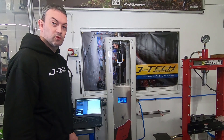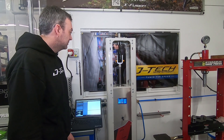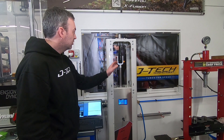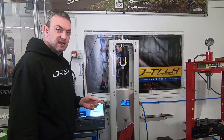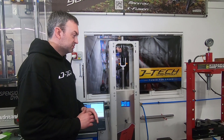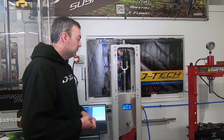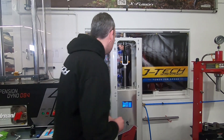In this test we're going to test two different shocks but three different springs. We've got a RockShox Super Deluxe Air with a Debonair air can first, then we're going to put a Meg Neg on, and then we're going to use a Super Deluxe Coil with a standard RockShox linear coil spring — to show you how much progression you get out of the bump stop and how similar the spring curve of the Meg Neg is to the coil.